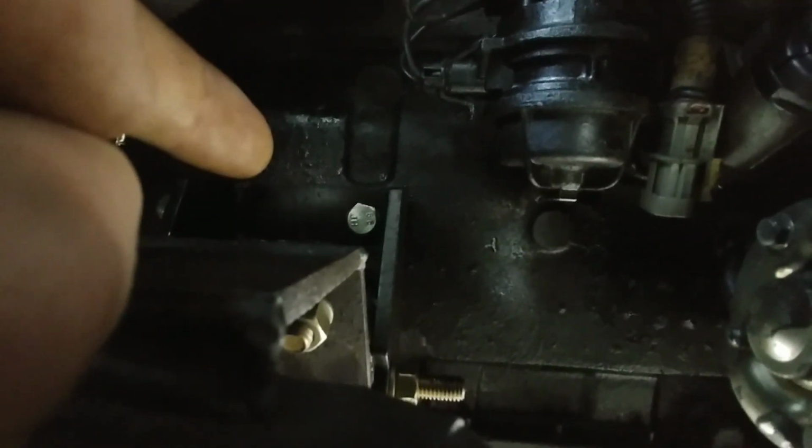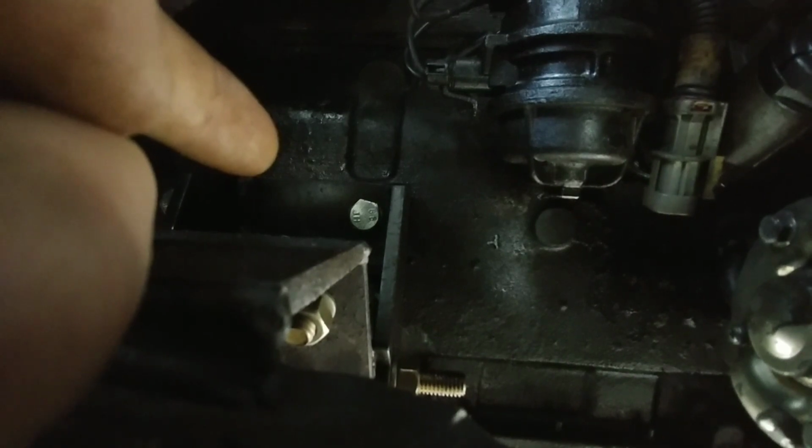So it comes in flat, and then it drops down this way, and through the center of it I have a reinforcement plate. I didn't want to go fully boxed, and I think it is much stronger than the factory one, because the factory one was like paper thin compared to the 3/16 steel. It's welded on both sides, top and bottom, reinforced. And up here, the frame curves down, so I put a little tab in there that keeps that nice and flat. Those brackets up there are the ones on Summit Racing to convert, actually for the older trucks, the 87 and back. They share the same mounts as the IFS trucks. So it all worked out really well.